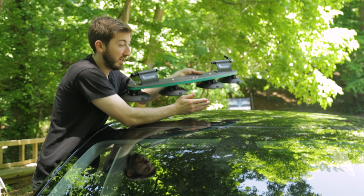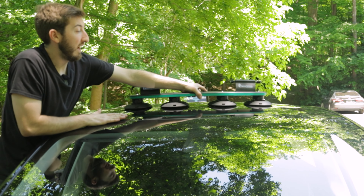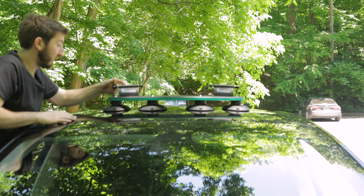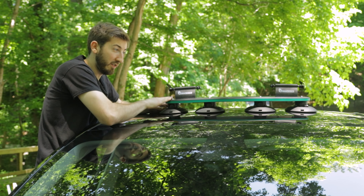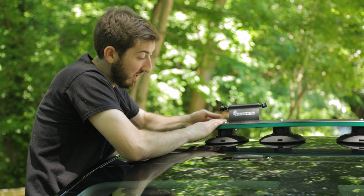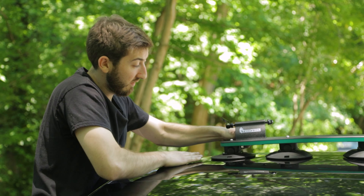Again, we're going about 11 inches back from the windshield for the front rack, and we already have ours marked. For centering, you can use the camera in the middle of the windshield as a guide. Once you've got it positioned, it's as simple as pushing down firmly on the first suction cup on the side and pressing the button — just keep pressing until the suction cup flattens all the way out.